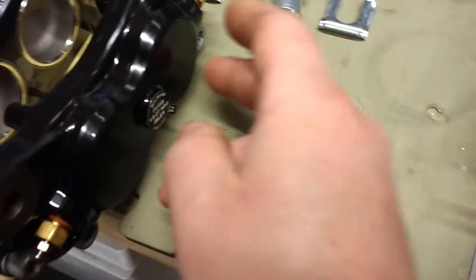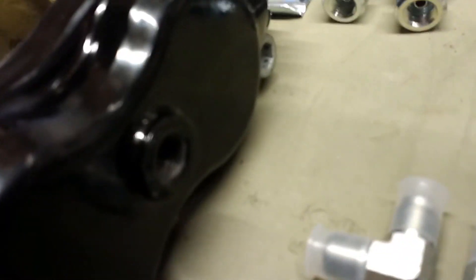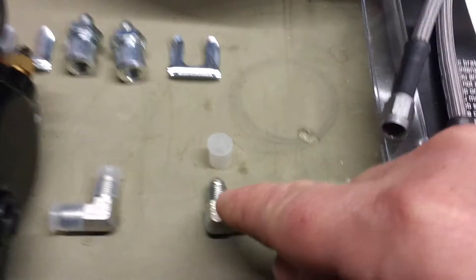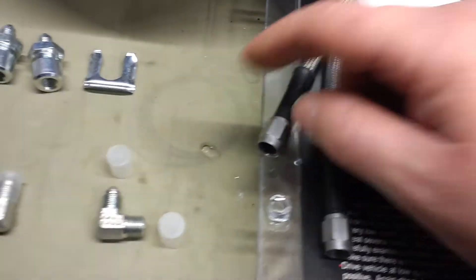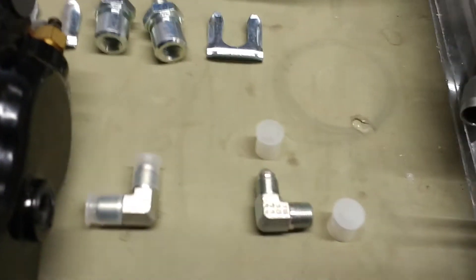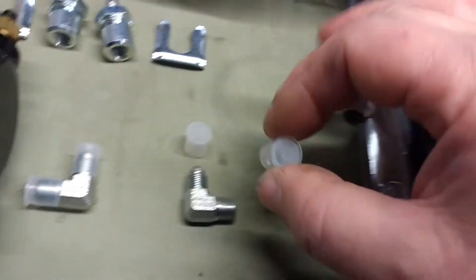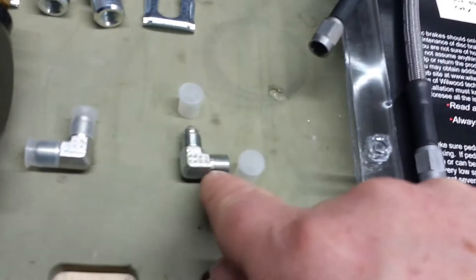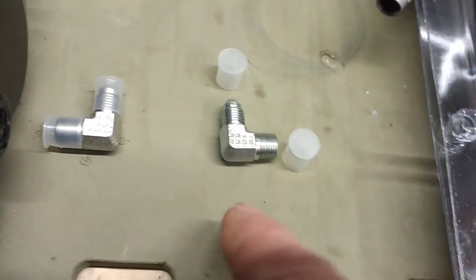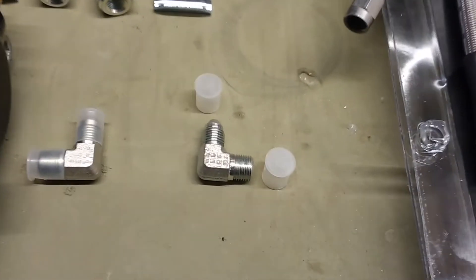The fitting goes in under this little hole here. If we pull the tab off carefully — just to keep it safe and keep dust out — there's a thread there. There's a 90-degree bend fitting with a conical taper on one end that goes into our line, and the other end goes into the caliper. The fittings are marked — one says 'U 3/8' and another says '1/8.' Clearly that's not one-eighth of an inch, and one is tapered while the other is not. So we need to do some homework on what's going on here.